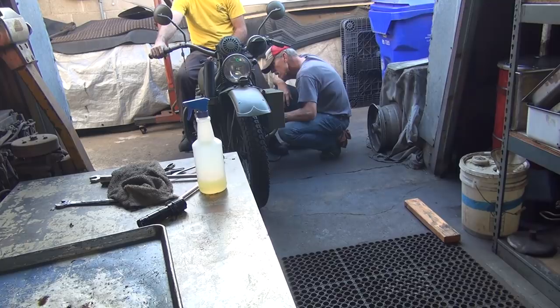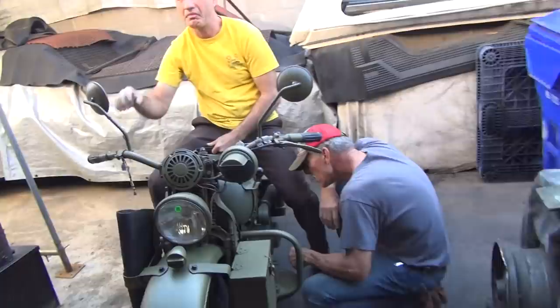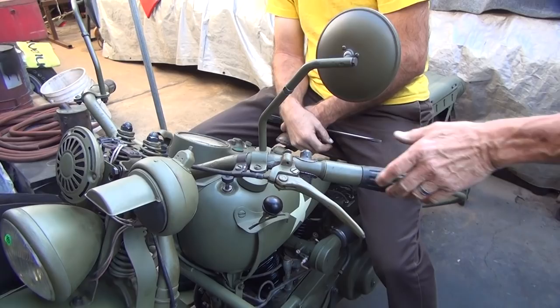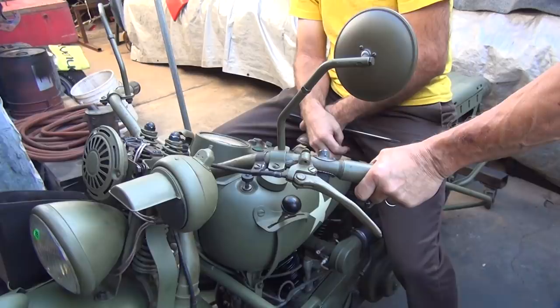Cable on this thing. It's a screw, because it's loose. Well, you can put a new one of those. You notice how it has that variable idle speed on this thing? Yeah. I had it fully shut and it was still going. It was hauling, it was accelerating. Why? Because the throttle cable's not tight on the frame where you tighten the clamp to it.